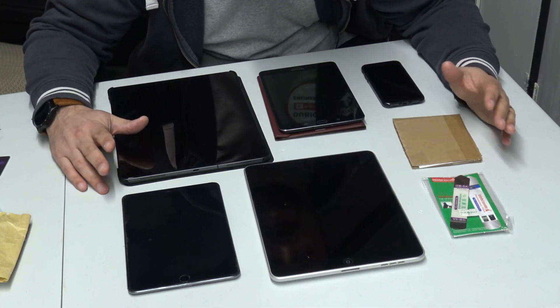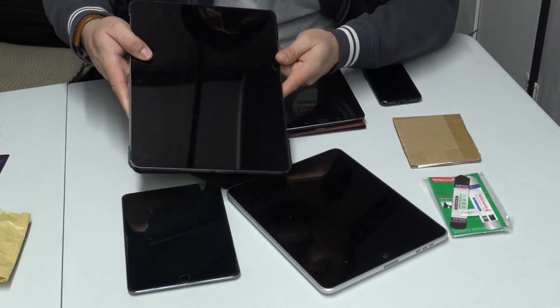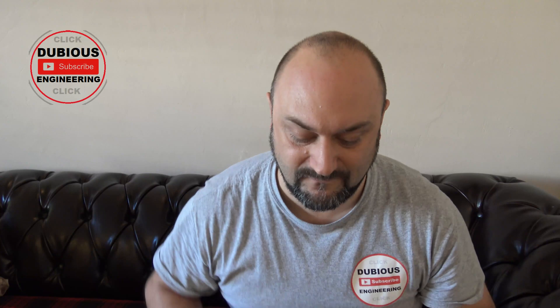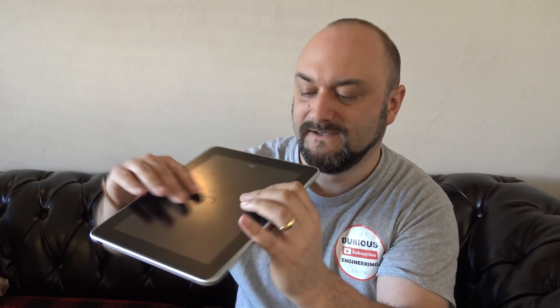If you're anything like me you might have a rather large collection of various different tablets, some older and some a little newer — this is the iPad Pro. The wonderful Samsung Galaxy Tab 2 is all up and running with its fresh new battery. Key thing to note: gaining access to the battery in this is relatively easy because it's just a plastic clip-on back. Whereas with units like these iPads, in order to get the glass away from the aluminium solid housing you need to heat them up, and there's a high risk of cracking the glass — these are much harder to do.